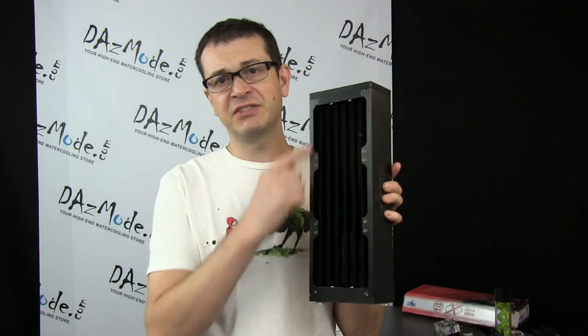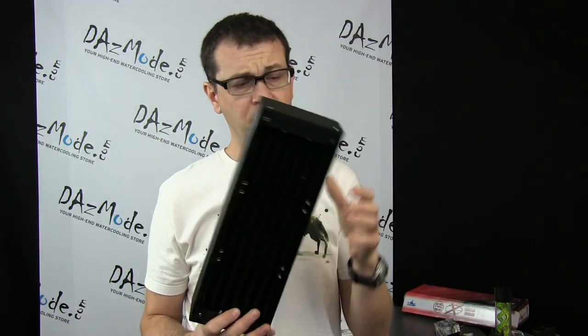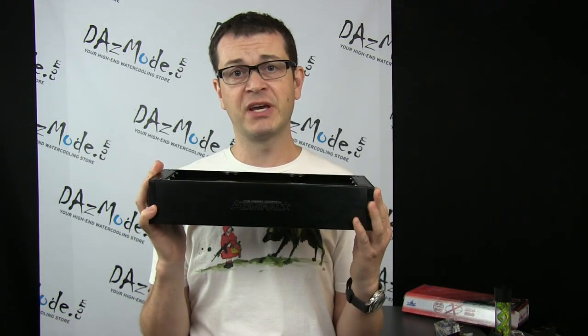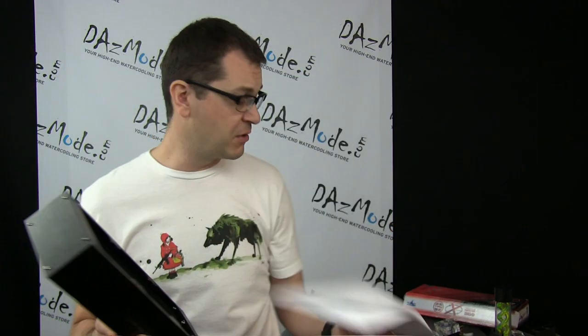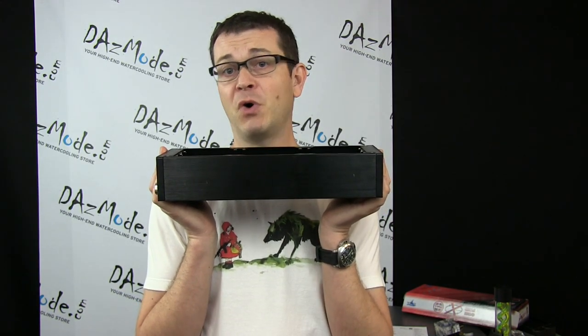So what are the major differences? Unlike dual-pass radiators, this radiator is serial — all tubes go one to another sequentially, and it's a total of about nine meters of water path. I would expect that the longer water path would yield significant differences in performance. The truth is, if you expect any revolutionary performance changes, it's not going to happen. This radiator was already tested in a professional lab environment — I have a report, and a good deal of money was paid for that, with a temperature-controlled room and everything. The result, in a nutshell, is that the triple rad performed at similar performance to traditional dual-pass radiators of similar size.